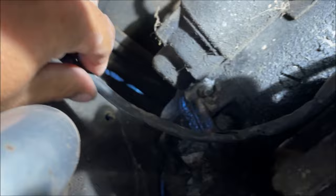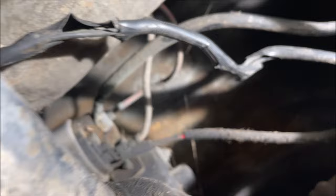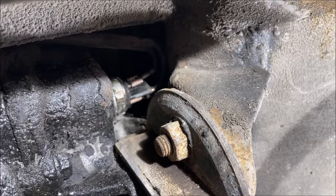We're going to pull the wire out into the engine bay to inspect it because it could have possibly come in contact with the axle right here. See how it's all screwed up - just follow it, follow it. There's the reverse light switch right there. Go ahead and pull or pop the terminals off.